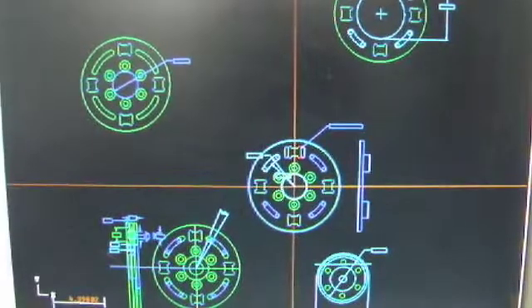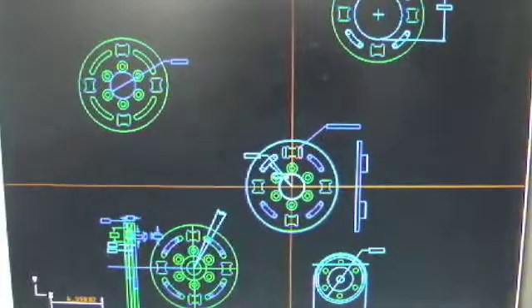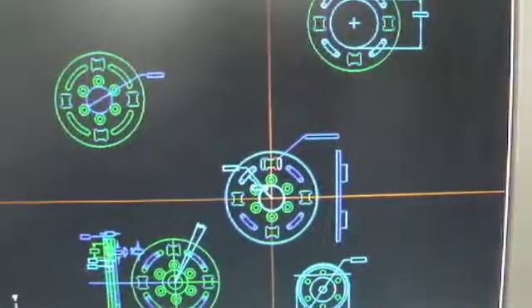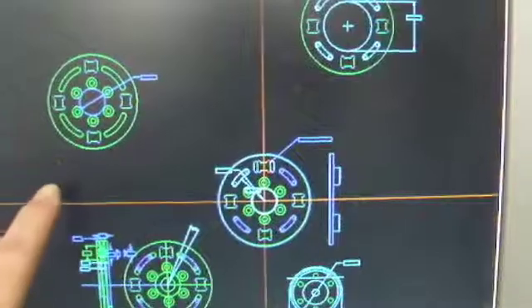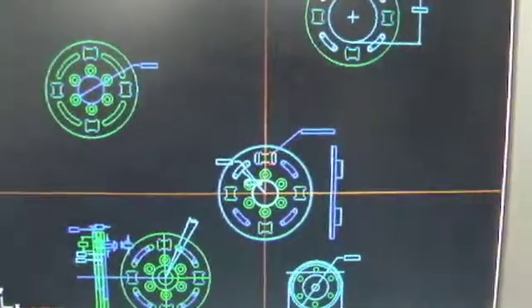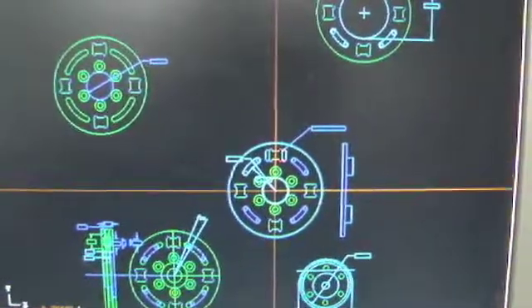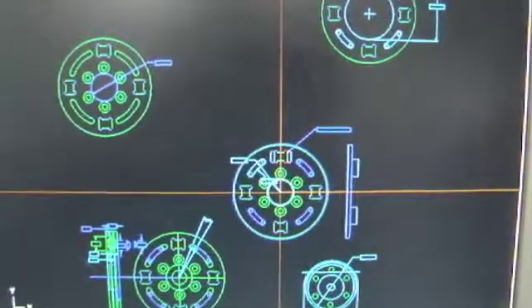This is the CAD work for the drive coupling plate. It has a center isolated spring-absorbed plate outside of two plates that are all bolted together. The inner floating plate — which is what we're pointing to right there — floats on the spring bed, which absorbs, as we said, seven and a half degrees each side of zero on rotational vibration.